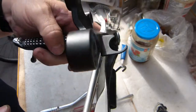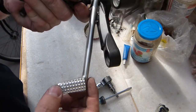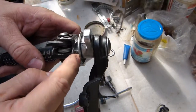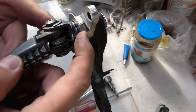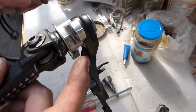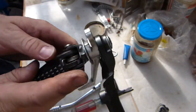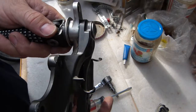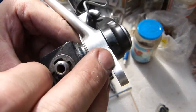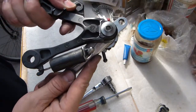So this is how the fitted spring looks. A couple of notes about this fabricated 1.3 millimeter washer here. It stops the pedal from rotating sideways, and that's fine. Now this stainless steel washer is fairly soft, but it's still harder than the aluminum, but softer than the weld over here on the steel bracket for the foot peg. There's also somewhat of a forcing now, aluminum to aluminum, but that force is spread out over the entire circular area wherever they still contact each other, because there's a gap there where so much of the material wore away. So that's how it should look in normal operation.